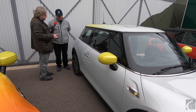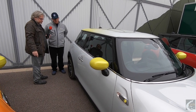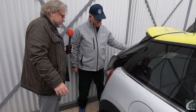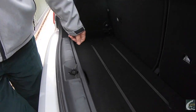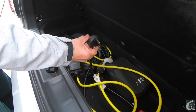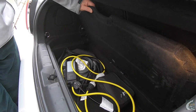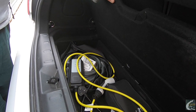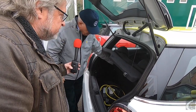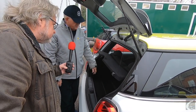The batteries form a T-shape — across under the back seat and down the middle tunnel — which is why it's limited to front-wheel drive only. The electric motor and inverter are under the bonnet. Opening it up, there's a large plastic cover, and below it a very strong frame that picks up on the original mounting points. On top sits the inverter, which does the variable-speed drive for the AC electric motor, converting the DC battery supply by varying voltage and frequency to control motor speed and power output.